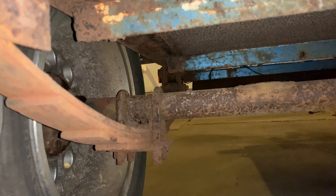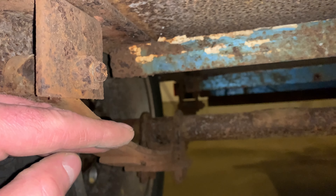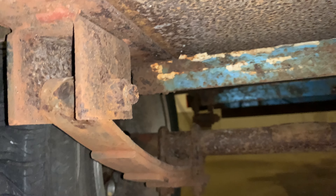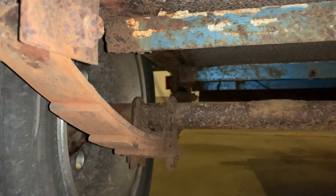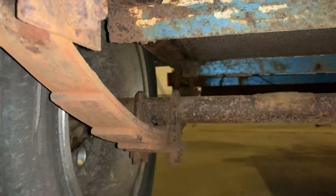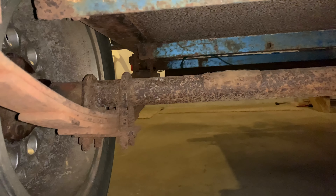That's what the mechanic told me. It may actually be better to let it ride on the axle, because if you had an inch of clearance and hit a bump real hard, it's going to slam together and smack the axle with force. If it was just riding on the axle already, it would kind of cushion. But he said give it about an inch or two of clearance. So I'll try that, drive slow when I'm loaded, and I'll give you an update the next time I load it with firewood and we'll see.